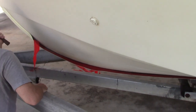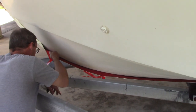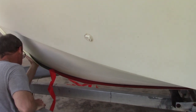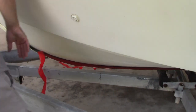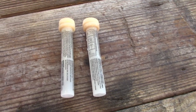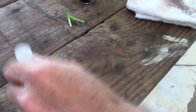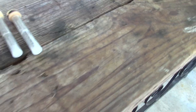What was the purpose of sanding it? For it to just put an adhesion, and then you put a primer on it. What kind of primer did you put on it? It comes with some 3M primer. So there's a primer thing in the kit — it's over there on the table. These are the little vials of adhesive that came with it. It's got a sponge, just put it on there and rub it like that. So you sand it first, then rub it down with that. You have to let it dry — it almost dries instantly, but it says wait 5 minutes before you apply it.